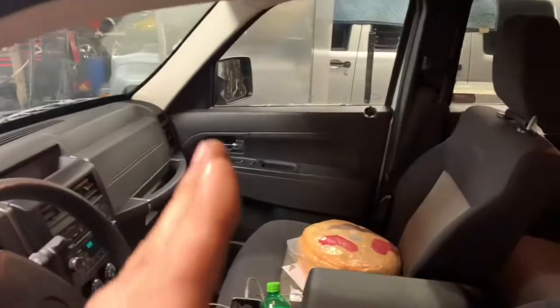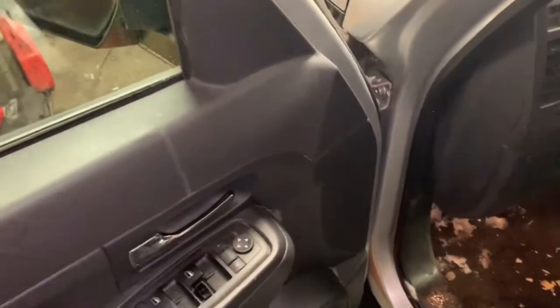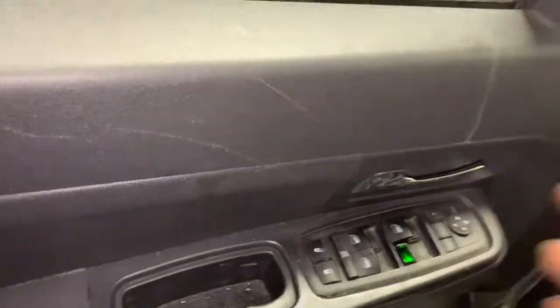A lot of times on these, just real quick, you'll have the passenger side window that will not work from the driver's side switch. But the video is really not about that. If you have any other windows that aren't working — with the exception of your master window on the driver's side door — you want to go ahead and open up the door, cut this ribbed part apart, or you can simply pull it out, and you'll find a broken wire in there. I've done about a dozen of them, so check that out first before you replace your switch. Simply fix the wire — pretty easy stuff.